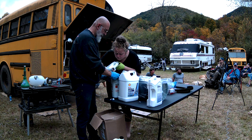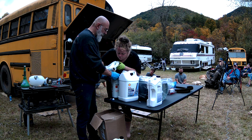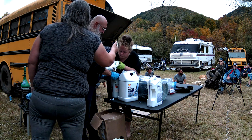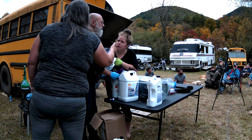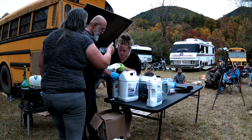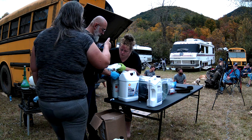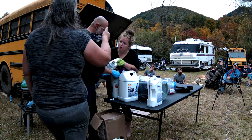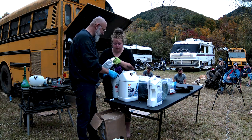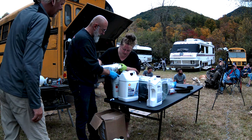There are people that will argue, and for good reason, to fill the dirty side of the filter. If there's debris in the oil itself, or you've left it open, there are mechanics that would argue to fill the dirty side of the filter so when you put it in, it won't suck whatever could have gotten in it into the clean oil. But it's really slow to do it. The dirty side is the outside. A lot of people suggest to fill the oil from this side. It's a little late, but no one does it, but if you ever get debris in your clean oil and you're pouring it, it could get in that clean side.